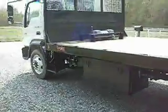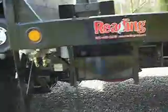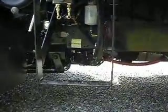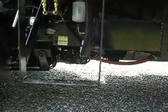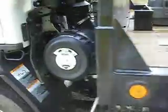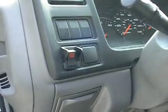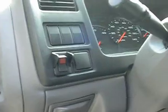Over here, getting to our controls, we have our wet kit set up. You can just see the PTO just sort of hiding back in there. There's the engine — they tuck way back in there. And in here we have our nice PTO engaged switch. One switch, push the button, it automatically comes up to roughly 1,200 RPM or so, and away you go.